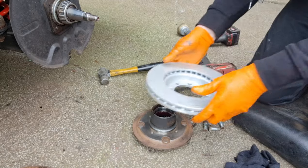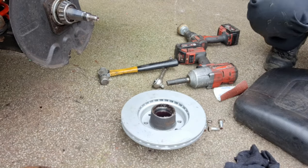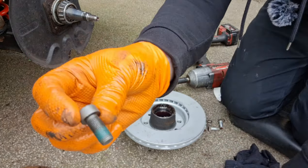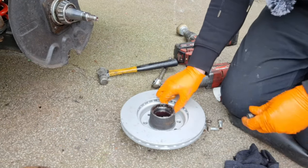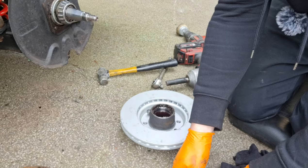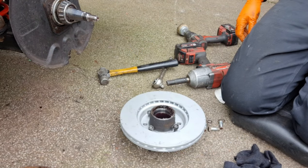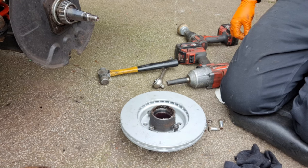Right, and then new disc, Fiat 500, 16 valves, machined out to suit. And because of the holes and the shape of the bolts, this is just generally better. High tensile, actually flywheel bolts, so they'll be a lot stronger. Can't remember if I drilled these out or not. Sure I did. You can get them a lot tighter, and also they're a lot stronger with their own thread lock. But do I need to modify that hub before I do? I think I do. One job turns into two or three.